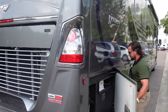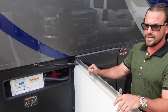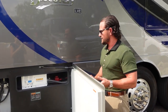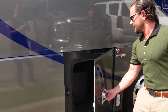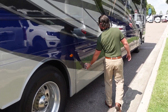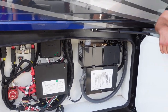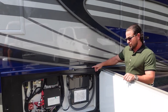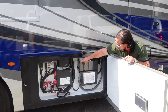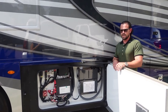On the passenger side, you have the inverter and the hydraulic reservoir for the leveling system — a 2,000-watt pure sine-wave inverter. It hooks up to your six batteries and allows you to run outlets, the refrigerator, and TVs right off battery power without running the generator. Behind this bay you have your fresh, gray, and black tanks in a wedge block design, along with the automatic transfer switch, central vacuum system, inverter disconnect, and solar charge controller. This unit has 325 watts of solar, upgradable to 525 watts.